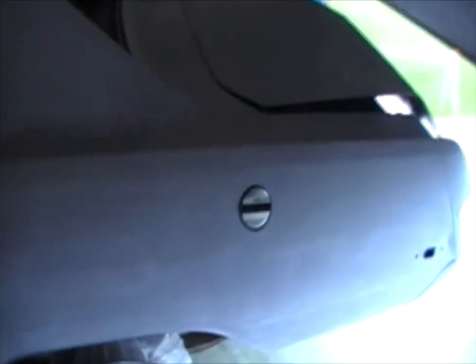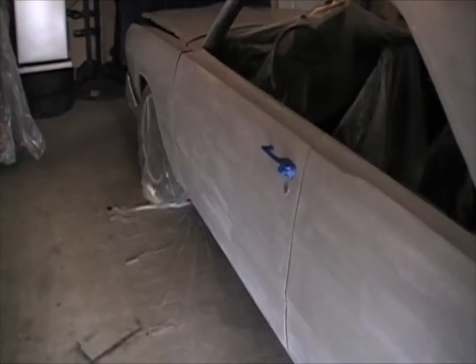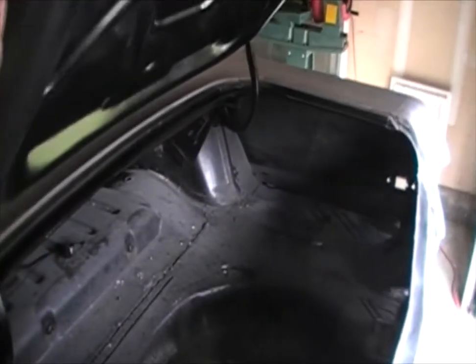You need to make sure that you've got the car all the way perfect. I've spent hours and hours sanding. After I primed it, I took it down to bare metal, primed it, then had to bondo and spot putty all that good stuff. Now I've got it all ready and washed down with soap and water on all the areas I'm going to paint. I've taped off what I don't want painted — the race seats, tach, and all of that. Under the hood I've covered up the engine because I want to paint the engine bay and didn't do it prior to putting the engine in.